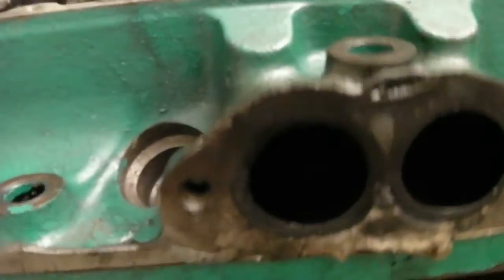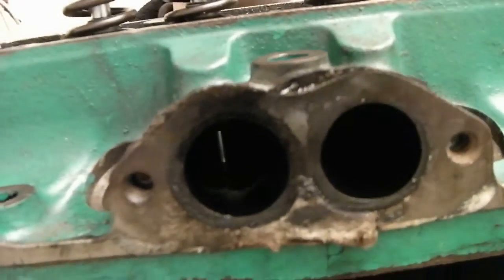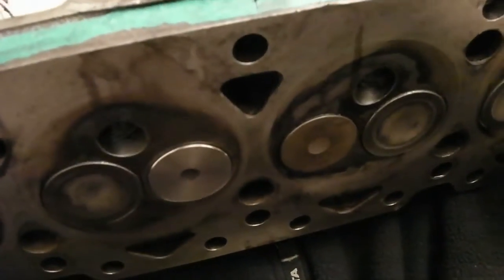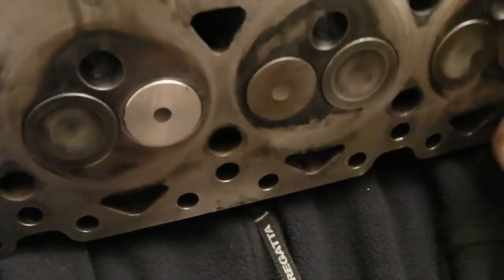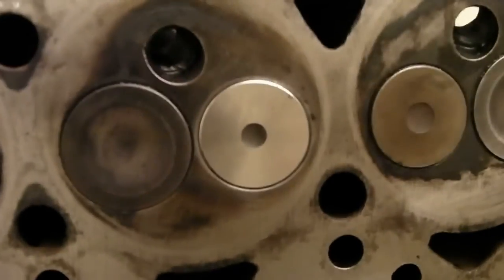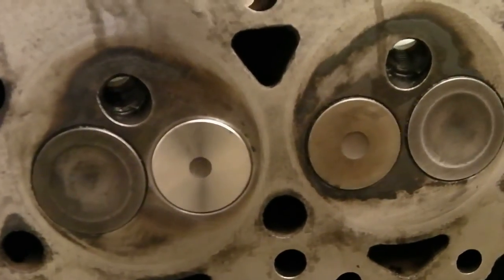You can actually still see the WD-40 in there — it's not going anywhere. So yeah, that was a bent valve. I may have to consult with somebody as to whether it's legal to have a re-profiled valve, but that's the issue with this head. I could change them and just put the other valves in — that's probably the best thing to do. I'll carry on cleaning the head up, take all the valves out, and then we'll see about those valves.